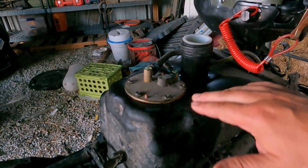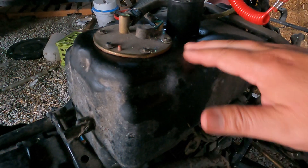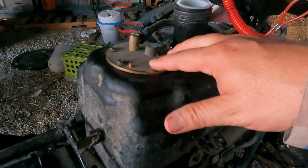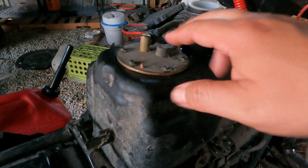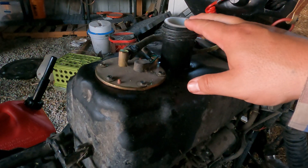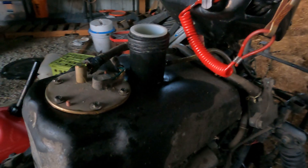Okay, that went in real nice. It looks like it's all grungy and crapped out, but it's not — there's nothing more you can wipe off of this. We did that with paper towels and WD-40. We put our screws in and barely touched them, then went all the way around — here to there, to there, to here — about two times around, because you've got a rubber seal under here and you don't want it to bunch. So we're going to put gas in, and then we should be really ready to start it up, barring the battery being dead or any other oddities.